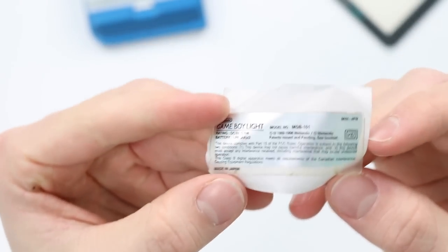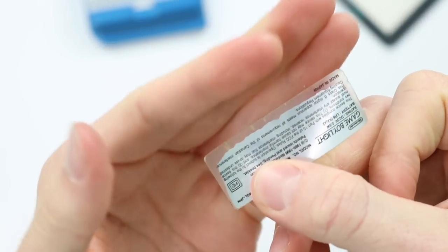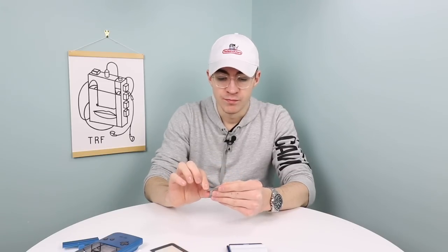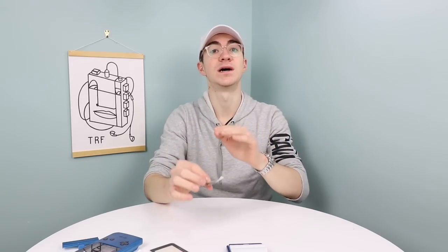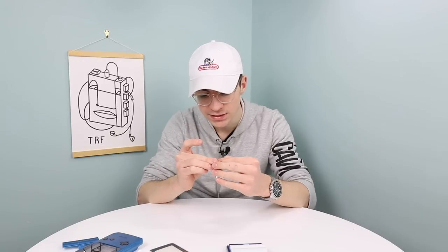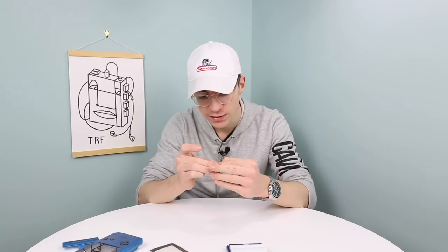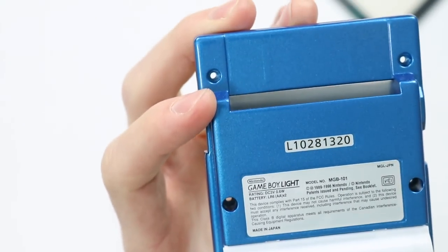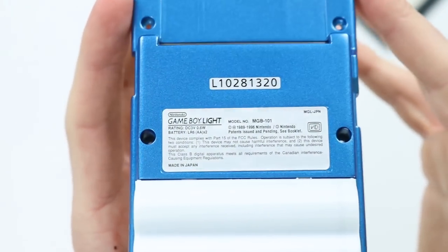Everything I'm mentioning in this video you'll find links to in the description. Next up, let's have a look at stickers. A lot of the stickers you'll see on old Game Boys are losing their silver part around the back — it rubs away and you don't get a nice silver sticker. There's also another coat of plastic on this sticker on the top, which can crease, and then dirt gets underneath it so it starts looking not very nice. You can actually take that off and separate the layer — I've done that in the past and put sellotape over the top, which is a viable method, but it doesn't ever look quite as good as a nice new sticker. There are sellers that sell replacement stickers and they look absolutely excellent. They've also got replacement serial number stickers, though the downside is we'll all have the same Game Boy Light.